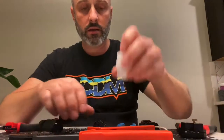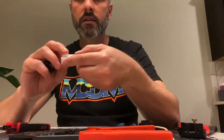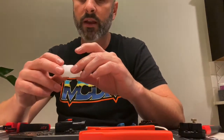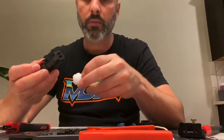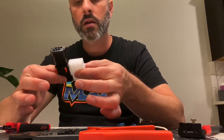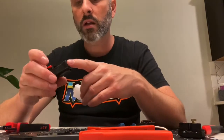A couple things I want to walk over. The OEM style looks like this — this is the OEM style six-part plug. You can see it's fairly flat, it's very boxy. It's white — you can see this thing from space. And on some of these old cafe and bobber bikes, you don't want to see your wiring very easily. So I like these because they're black — you can't see them as well. They're bigger, they're narrower — not as fat width-wise — but they're taller and they're deeper. You are going to get a little bit more plastic, but they're harder to see, they're going to keep your stuff lined up, they're waterproof, and they're super high amperage and heat resistant. They're made for cars — no problem for a 12-volt motorcycle.